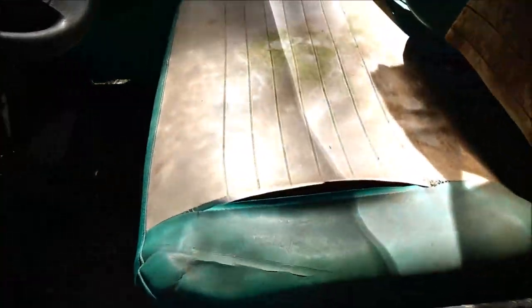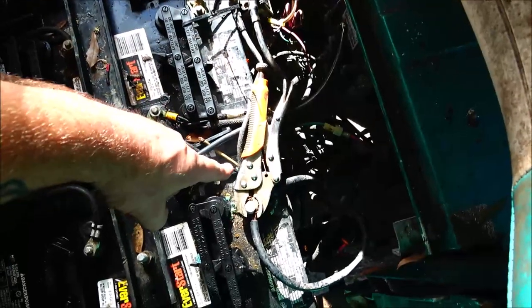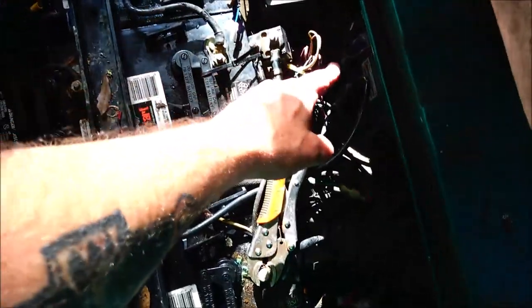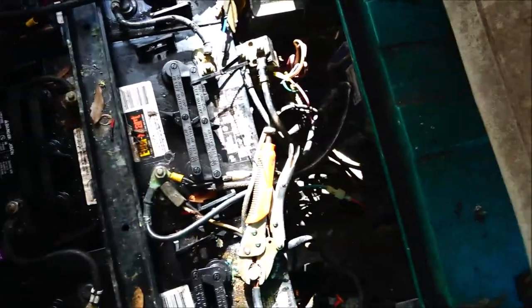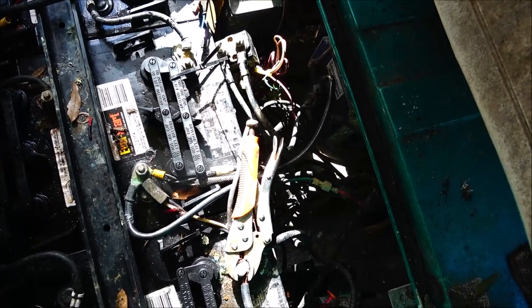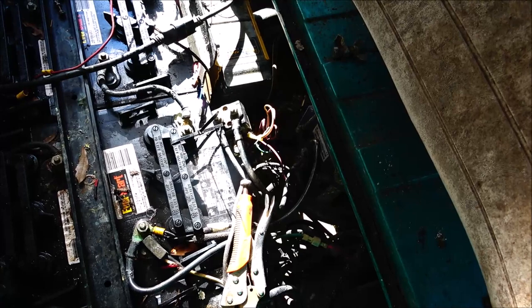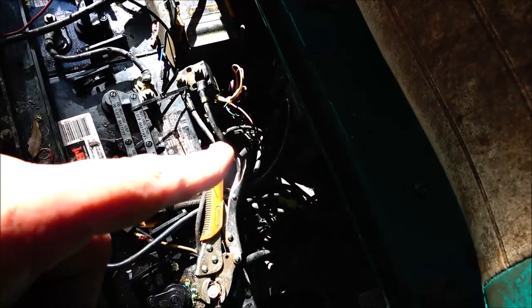The batteries aren't that great, they're getting old. I need cables and all that. Right there is the solenoid — it mounts way up underneath over there. I just got a wire tied there for testing. I took that off because everything I tested tested good: the switch, forward/reverse switch, the potentiometer which is kind of like a speed control. When it wouldn't start that one day, the batteries were fully charged, so I checked the charger anyway and I checked that little computer box down there.